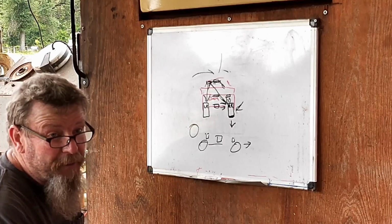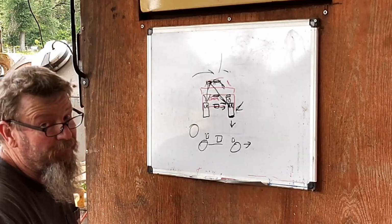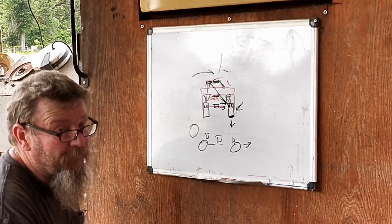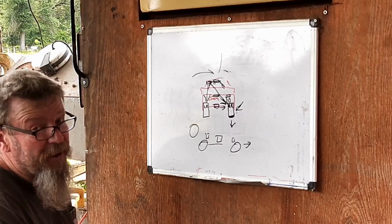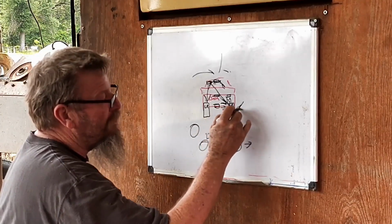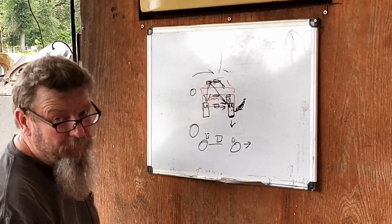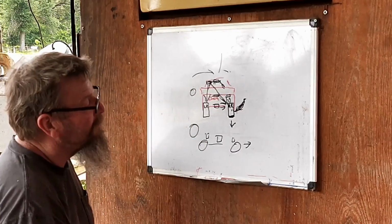And I learned a lot about that driving for David Hayes, who owned the spring shop, and he would re-arch our right rear springs often, like every third race. I'd re-arch them maybe once a year, right? You come out fresh for the next year. And he'd re-arch them every 3 races, and I was amazed at the difference in side bite. You would put more arch in our leaf spring on the right rear, and we would actually start to wheelie these cars a little bit. And it was just from going in, planting that right rear, and getting a hold of stuff.